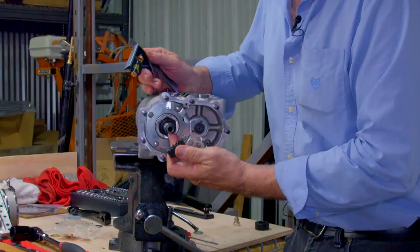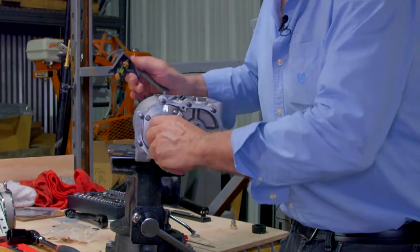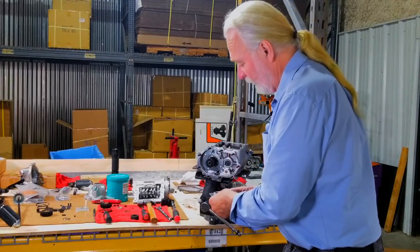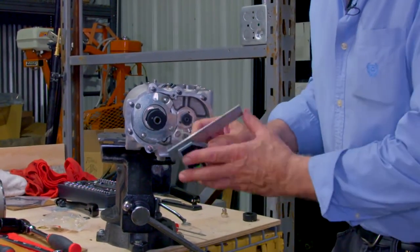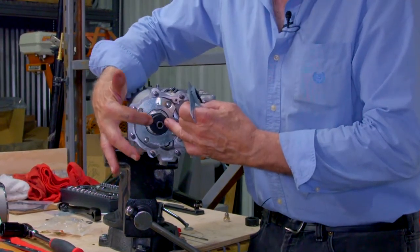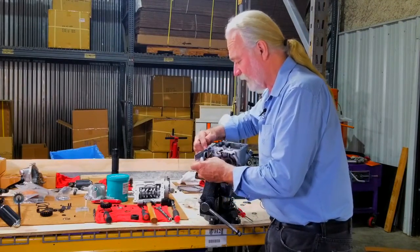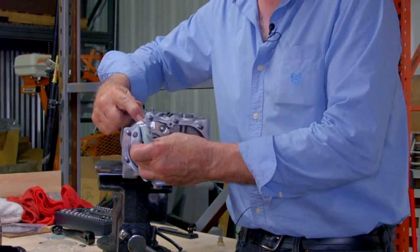Clean, dry main shaft taper, clean, dry gear, whatever you've purchased, just with no key or anything, draw it onto the main shaft by hand. Set your machinist scale for 5/8 of an inch. From the outer surface of the clutch gear, the stationary gear for the Kickstarter, to the gasket surface, we want to be flush at 5/8 of an inch. You can see here that I'm over an additional 1/8 inch here.